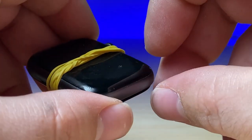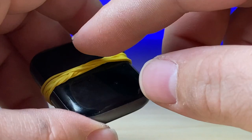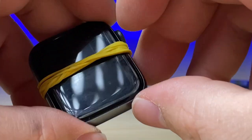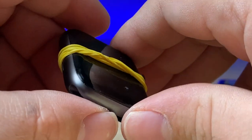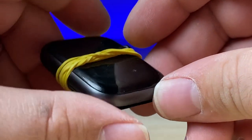This cold press glue doesn't harden like a lot of glues do — it remains in somewhat of a bouncy state, which allows the screen to still activate with force touch sensitivity. It also gives the screen that cushion the gasket provides so the glass isn't pressed up against something extremely rigid; otherwise it would crack on impact much more easily instead of having something to absorb the impact. Once the adhesive is cured, we'll give it one last clean up to make sure there isn't any residue, and this watch is back to full life. As you can see, replacing the battery might not be as tricky as you thought. I hope that after watching this video you feel more confident in trying this battery replacement yourself. Like and subscribe if you haven't already — thanks a ton for watching, we'll see you in the next video.